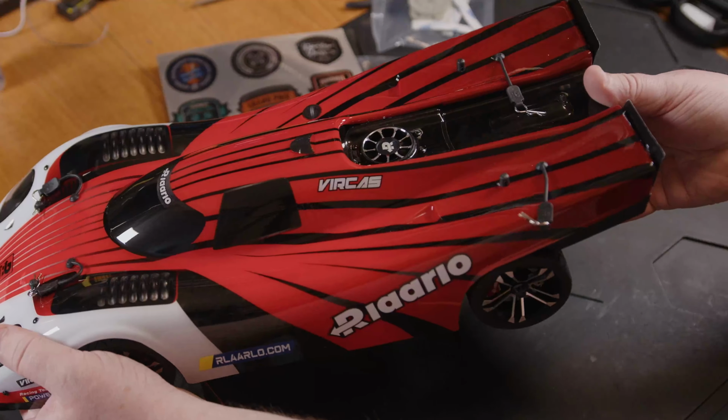So they are the serrated type wheel nuts. They are aluminium hexes with the rotors, but to get that aluminium hex off, you're going to have to remove the rotor, sort of your brake caliper if you like, and you can't actually get to the screws without taking all the arm off. So if you do have to strip this down, although these look pretty cool, they're going to be a bit of a headache. It does have the drive shaft size on them as well. You've got proper universal joint drive shafts. They're 54mm on the front. It looks like the back are 65.